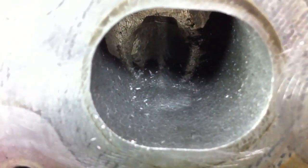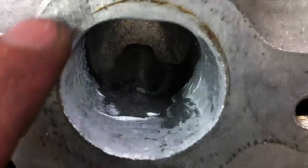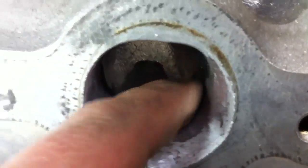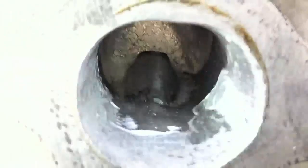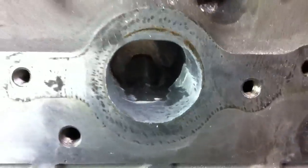There's a lump right here inside the exhaust port — that's for coolant. You don't want to remove that completely; just smooth down the outer edge, but do not open it up. That's coolant flowing through there and you'll break into water. On these two over here I've already started opening it up, just inside the lip inside that line, and then we'll go in and smooth it out inside to open it up on the upper side of the port.